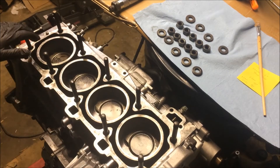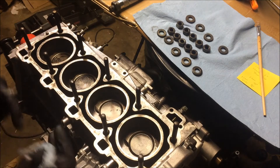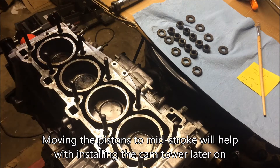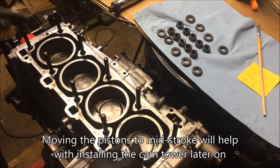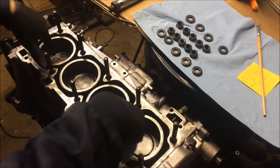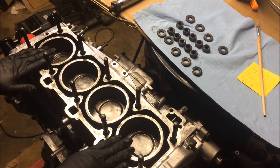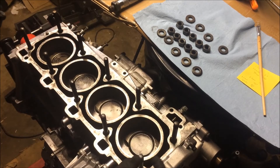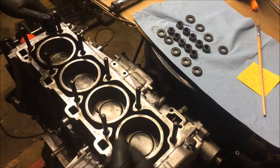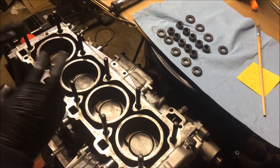I now have the pistons at mid-stroke and you can see how they're all lined up. The reason I've done this is because once the cylinder head is on, I won't know where the pistons are — so when I try to install the cam tower, the valves may actually open into the pistons, and we don't want that. When the pistons are down at mid-stroke, you can put the cam on, the valves can open all the way, and you can turn the cam back to TDC without worrying about the valves smacking the pistons.